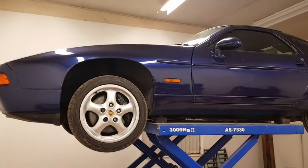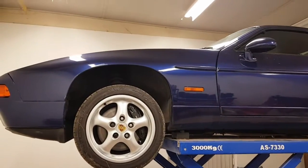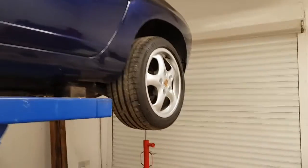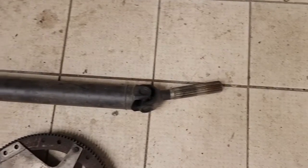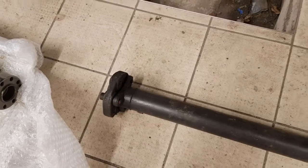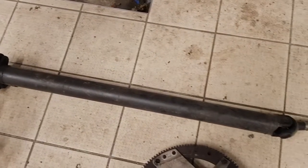With a lot of cars which are front-engine rear-wheel-drive, at the front of the car you'll have the engine and gearbox, and then at the rear of the car you'll have a differential. The drive from the front to the rear is taken through a prop shaft — one end goes into the gearbox, the other end goes to the differential through a rubber coupling. The engine and differential are mounted onto the chassis but they're not rigidly mounted together.